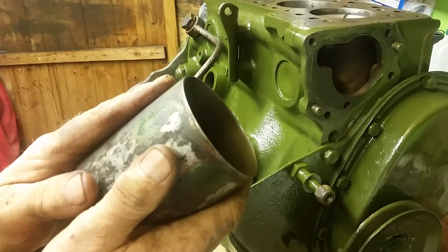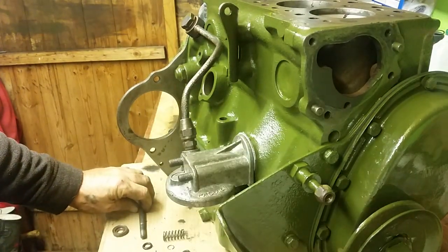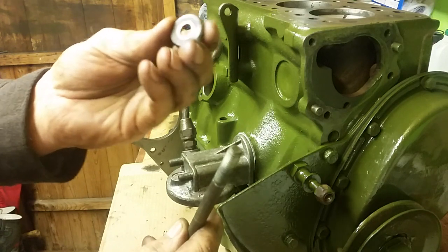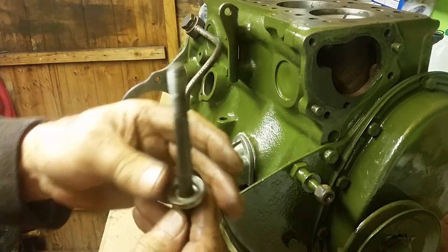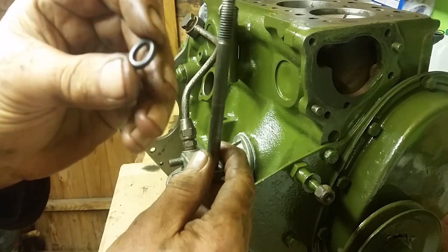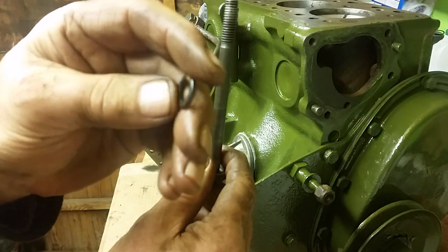This is just the assembly video - there will be a canister in it when I've finished. Starting assembly: we have a shaft that holds the filter up into the housing. The next thing is the spacer, which has a little recess in it - that recess is for a small O-ring. Be very careful when dismantling these. You can buy these O-rings, so if you lose one or yours hasn't got one, don't worry.